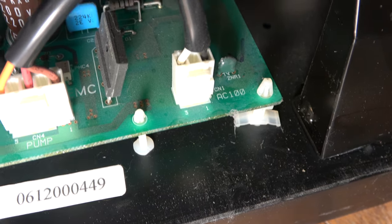So looking at the circuit diagram, we had 13 volts, I think, in from a regulator. And then we had the 5-volt regulator, the 7805, to ground, and 5 volt out, and various capacitors in various places. Then this goes via the interconnection cable to, so remember there was the green and yellow wires here, to this main board here.